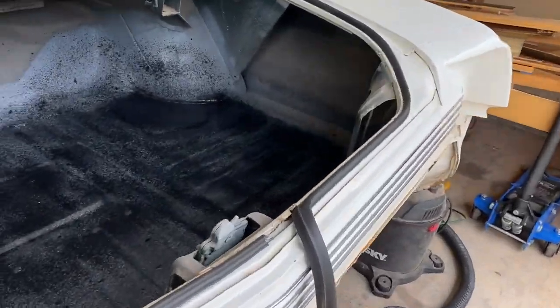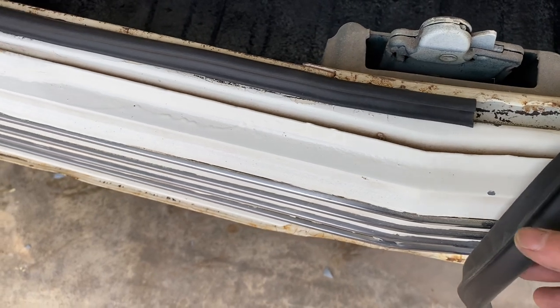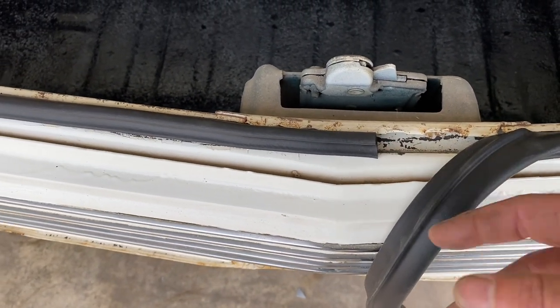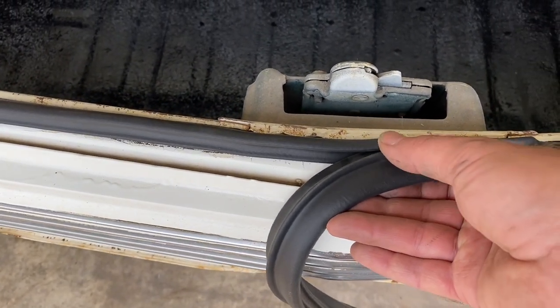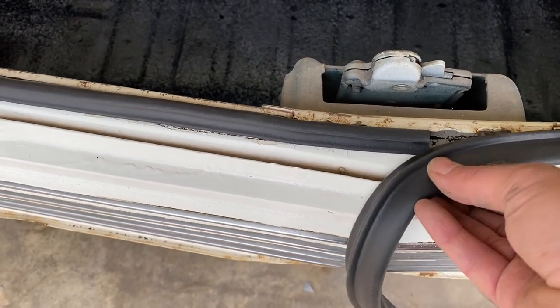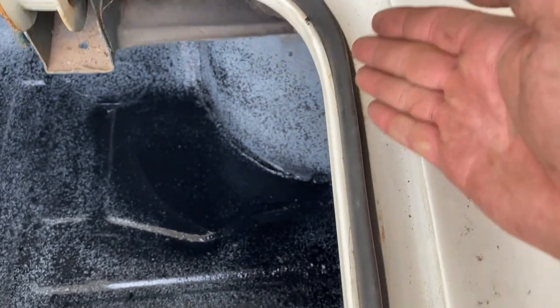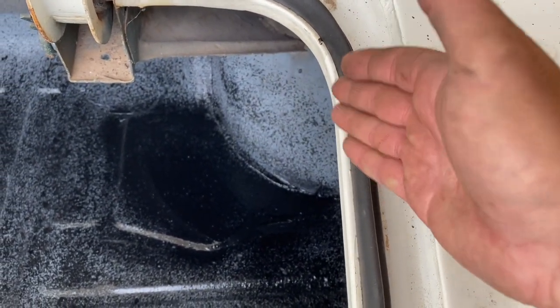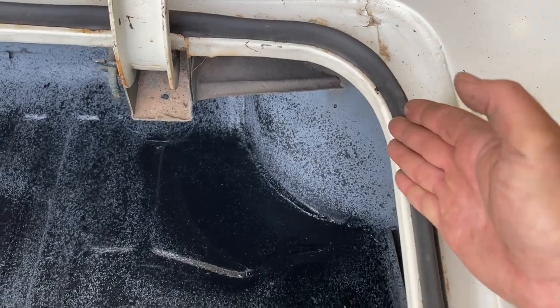Before you glue the end or put any adhesive in the end here, before you do any of that, I've cut this with several different things, you know, razor blades, knives, whatever. Scissors do the best job. You don't want a big gap there. So I just use scissors. I go ahead and mark it, give myself a little bit by pushing this back. And I forgot to mention, whenever you're in the corners here, you want to push it back. When you're wedging in, you don't want to wedge straight down, you're wedging towards the curve. Towards it, not straight down, towards it, this way. So it looks really, really good. That seal is gonna work.